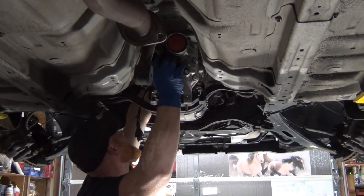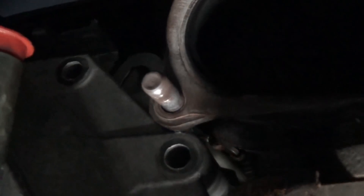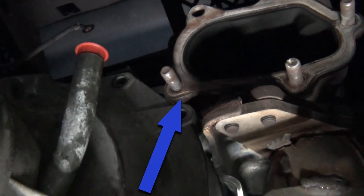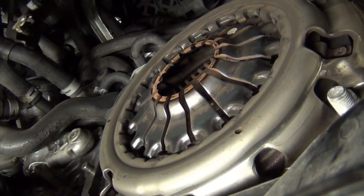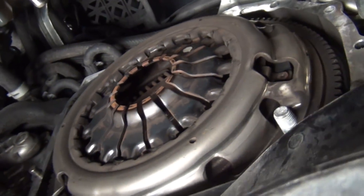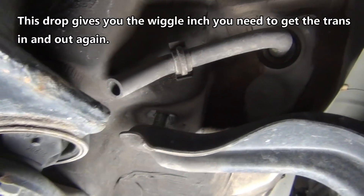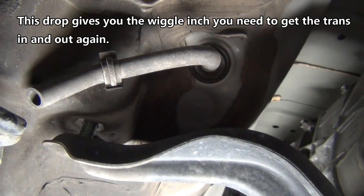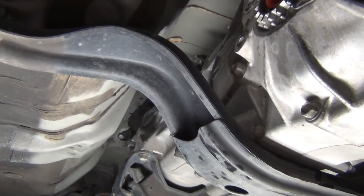Let's see if I can hold this and walk it off the rest of the way. I'm going to mess with the shift fork and get happy — I think we're off. But wait — the transmission has come back far enough to hit the turbo outlet side and it's not coming. Look at that: it just pries the turbo up just a little bit. This seems kind of stupid, but I'm actually faster pulling the engine than going this way — I don't go this way very often. It's just whatever you're comfortable and confident with. You can see all kinds of clutch dust and garbage in there. You can get in here and do your throwout bearing, you can get in here and do your clutch, and the whole time it's just sitting on this cradle. I dropped mine down just a little bit — you can pull one side and it'll hold with the other pretty well. Then you go back in about five or six threads and match it on the other side.